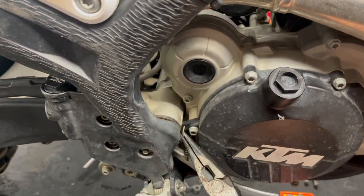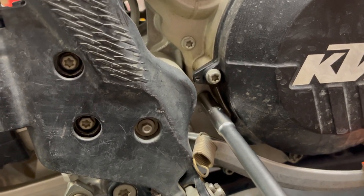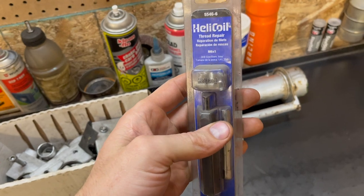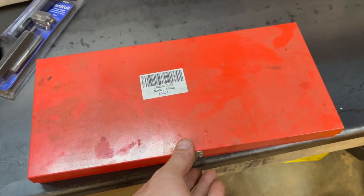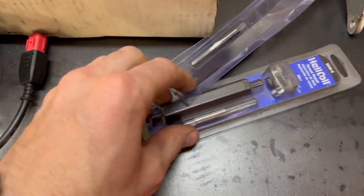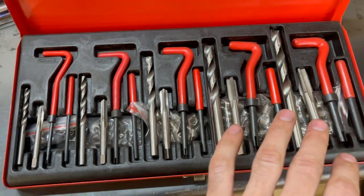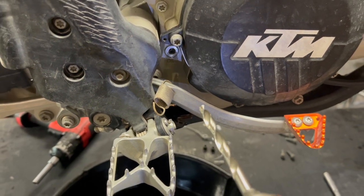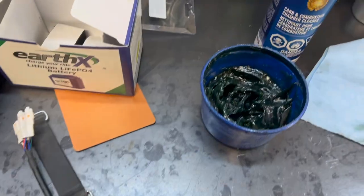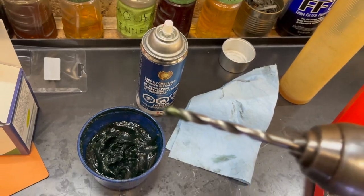This does take a few tools and a little bit of fancy know-how, but I'll show you how to do it. The check bolt is right there and the customer says it's stripped - oh yeah. So this is a Helicoil kit M6 by 1, I got this kit on Amazon. These are actually pretty expensive, but this kit was super cheap - it comes with a whole bunch of different sizes and all of the tooling that you need. The difficult part is drilling out that hole without getting all the shrapnel inside the clutch cover. The solution is pretty simple: clean drill bit, put a bunch of grease in the end.